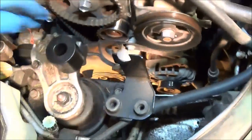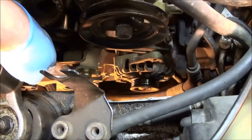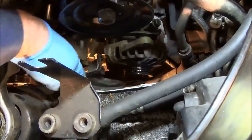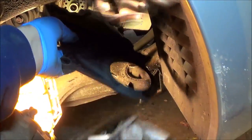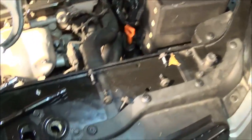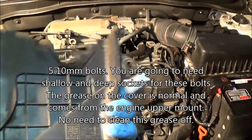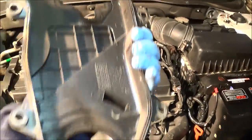I got all those bolts off, so now this should just come off — there you go. Once you maneuver this out, this is what the piece looks like — it's got five bolts, all the same size. Looks like we got a little bit of grease there — clean up the timing belt cover and make sure that you don't damage the rubber seal that goes around the lower timing belt cover. Place that aside, keep everything in order, and put the bolts back in.